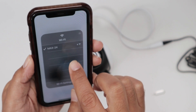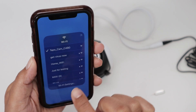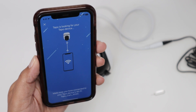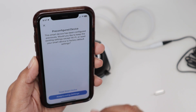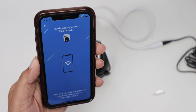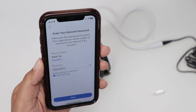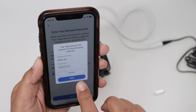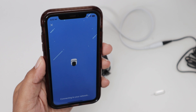It's a basic setup — I have another video showing how to set up. Basically you connect to the camera first; it becomes blue, and then you come back and finish the setup. The app found the camera. It's a pre-configured device because I just reset it. Since the system recognizes the camera was working already, I just keep existing settings. You just need to insert the Wi-Fi password, which is saved here already. Confirm, next. Connecting to Wi-Fi — Wi-Fi connected.